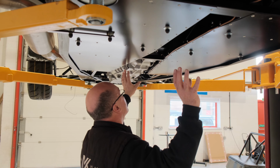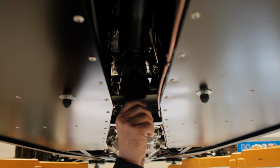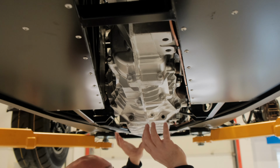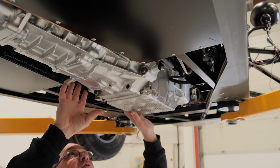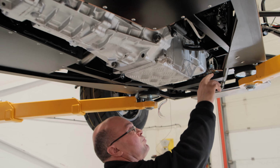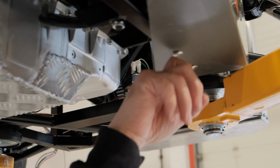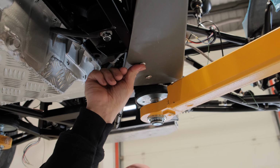Coming through, we've got gearbox mount under here, and it doesn't need a cover on that, it's protected up there. And then coming through to the gearbox, if you are getting under the vehicle, making sure once you run it up, there's no leaks coming from anywhere, from cooling, oil lines, everything else, brake lines, your brake tee, all of this. Securing of the under panel here, we drill and put 2 very large flange rivets in